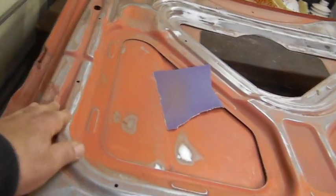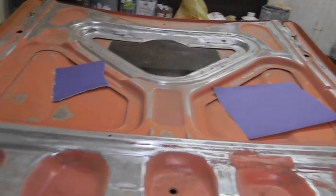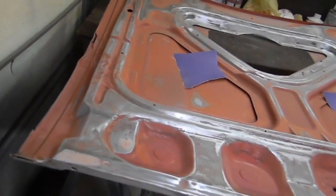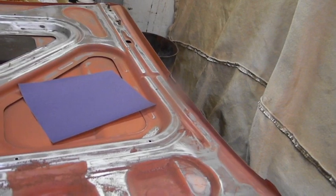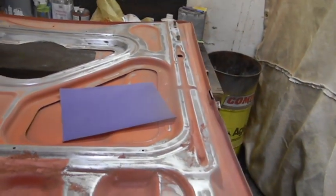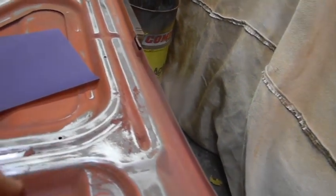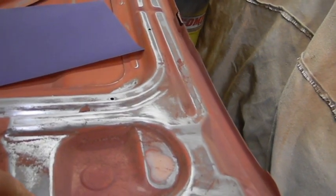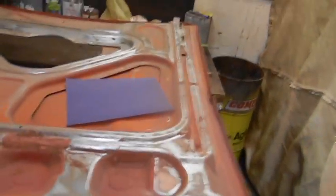I got the sawhorses padded, and just in this rib area — because the hood has a curve — I'm up against the curve on the other end to keep from damaging the hood as we're working. I can't put it even with the rib because if the hood slides over it'll fall. So yeah, we may have over-complicated it. I just want to make sure that I don't have any jagged edges — your feather has to be clean — because there'd be nothing worse than doing all that work and seeing rings around the edges of everywhere I sanded.